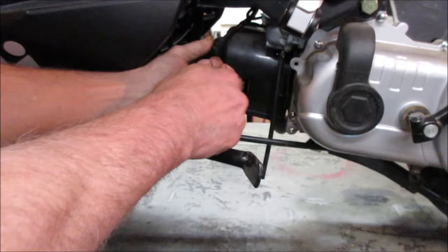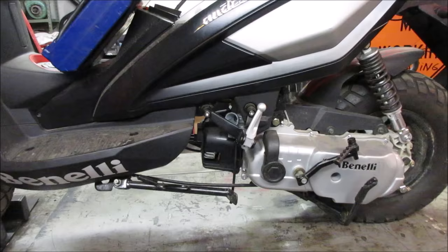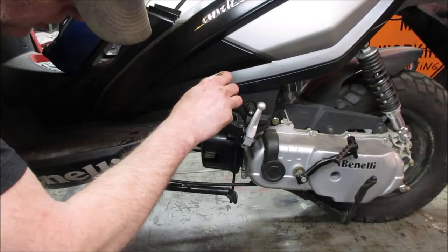But I'll tell you this, we're going to throw the spark plug back in it, and we're going to dump a little bit of fuel in the carb, see if she kicks off. Make sure we've got a working throttle, not frozen. Let's give her a little pre-mix down the throat. Give her a fire. Think she'll go? I think it's gonna go.